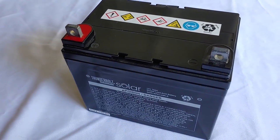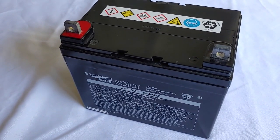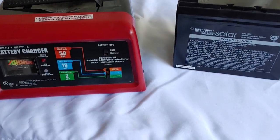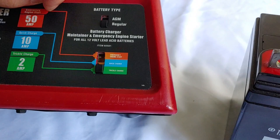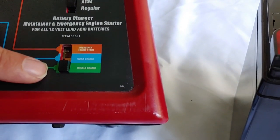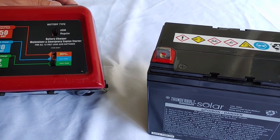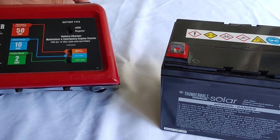We still want to make sure it's all the way charged before we use it or store it. One of the main ways to do that is with a battery charger. Most battery chargers will have a switch that says either AGM or regular. In this case we're doing AGM, so make sure your battery charger is set to that. We're going to have it at trickle charge, because the battery is already charged but we want to get it as high as possible. All batteries will go much higher when initially charging and then drop back down. Check the documentation on your battery to make sure you're getting the correct charge.